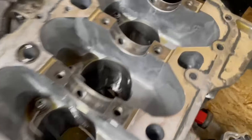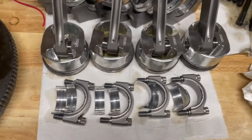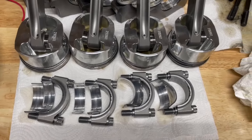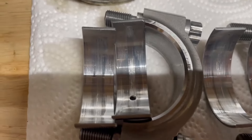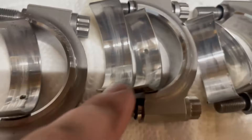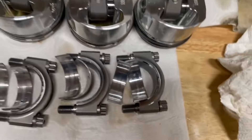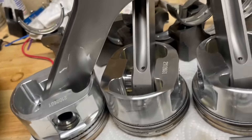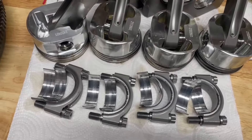There's no weird anything anywhere — you can see the cross-hatching is still on the cylinders. As far as rod bearings go, this engine was revving to 10,000 RPM — we did that probably 50 to 60 times, and it did one accidental rev to 10,800. So some wear on the bearings is to be expected, but considering how much of a beating this thing is taking, those bearings look pretty damn good. A little bit of wear in the middle. Cylinder 4 bearing is the best of them all. The rods and pistons themselves are all immaculate — they look practically brand new. No heat or weird bends or anything like that.